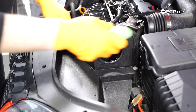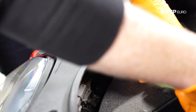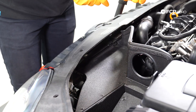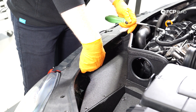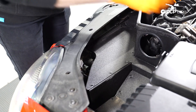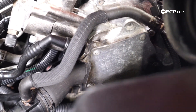There are two T25s up here that hold this to the front radiator support. If you have a factory intake, there's going to be a plastic air box and you'll need to access these T25s the same way — one on the right and one on the left. Once you have your intake out of the way, your brake vacuum pump is located right here next to your high pressure fuel pump, bolted to your cam timing cover. There are just three T30s that hold it in.